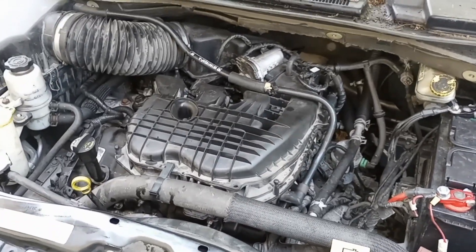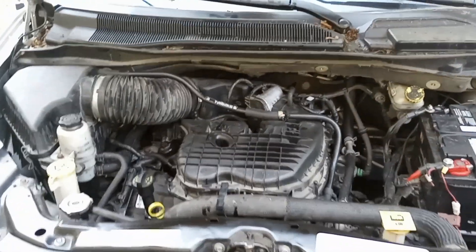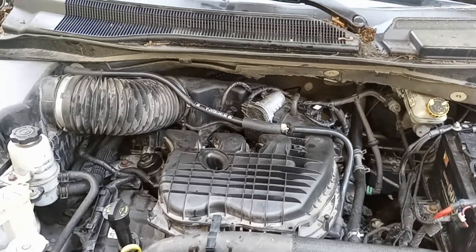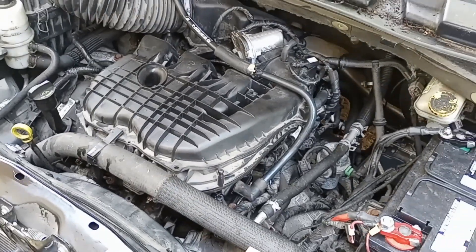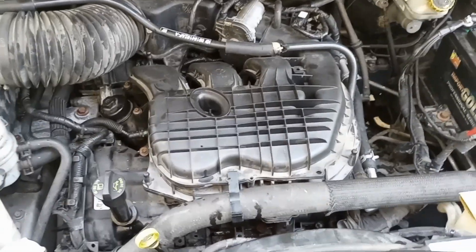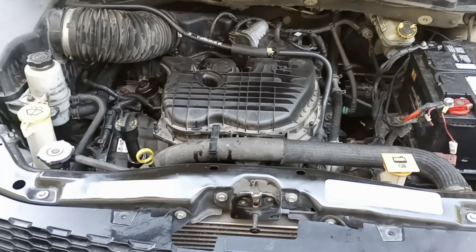Just in case you ever get brave enough to try it, I would say it is doable - just be careful. If I come up with any changes to my opinion I'll add them to the comments or description later. We ended up swapping reluctor rings on three out of four camshafts and we've got a motor that at least runs. By the way, if anybody has any words of wisdom on a dead miss on three cylinders at idle, I'd love to hear about it. It picks them up as soon as you rev it up and runs like a champ, but dead on two, four, and six at idle.